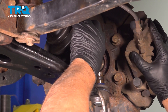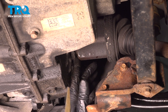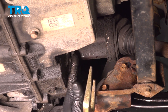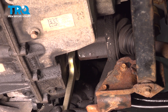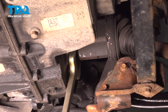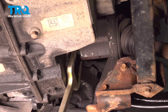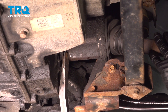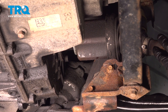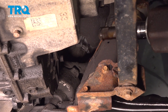I'm just gonna pull the axle out and slide that to the side. Now I'm gonna pop the CV joint out of the transmission — I'm just gonna use a fork. You could also use a pry bar, maybe even two pry bars if you need to. Just tap it to get it to separate. Now I'll use a pry bar and just pry it out. I've got a drain bucket underneath in case any fluid comes out. And it came right out.